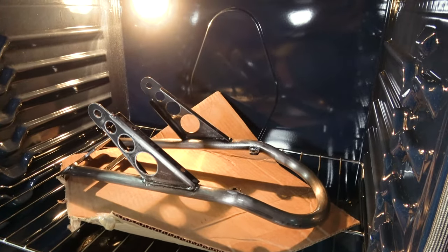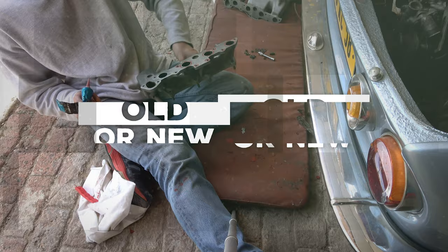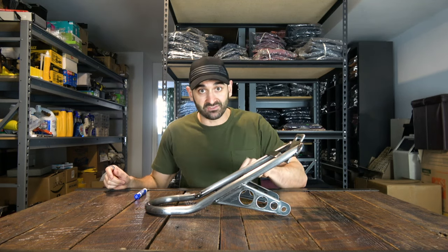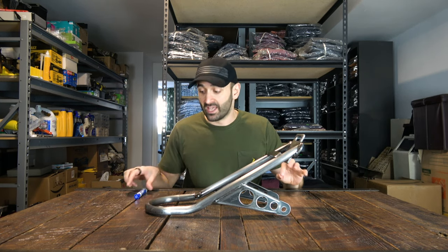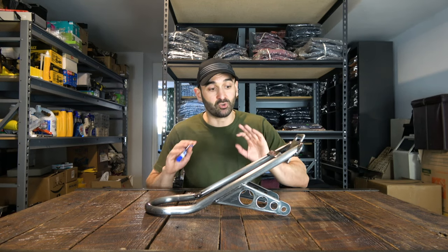What's for dinner tonight? Welcome to my channel, I'm Tristan Duran and this is my Cafe Racer subframe for my 1983 Yamaha Virago. On the last video I painted the entire thing. I made some runs, so I need to go over the entire subframe, see where I have the runs. I have my marker right here, I'm gonna circle where I have the runs and then I'm gonna wet sand to make it perfect.